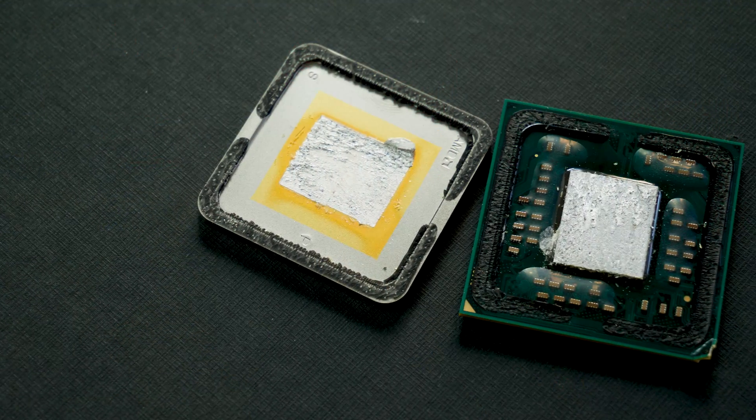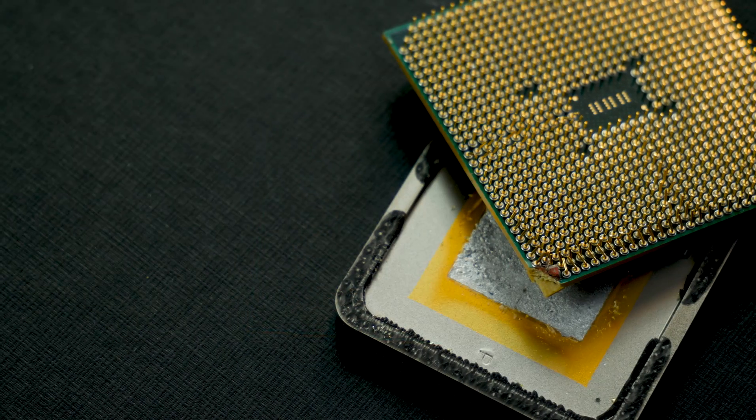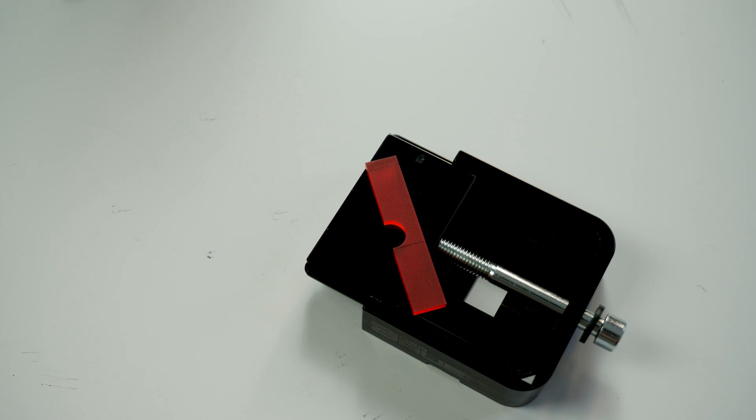For a funny reason — and it's not like I thought about this before — the size of the Intel PCB, for example of a Coffee Lake CPU, is exactly the same size as the AMD heat spreader. So we can just put the CPU upside down into the Delid-Die-Mate 2 with the heat spreader on the bottom, and then the slider will push against the PCB of the CPU to delid it. That's what I tried with the Kaveri chip first, which is why it looks a bit destroyed — the force on the edge is quite a lot from the slider — so I made an additional adapter.